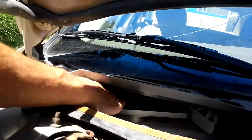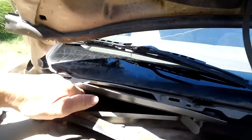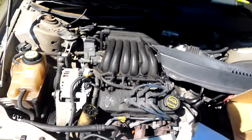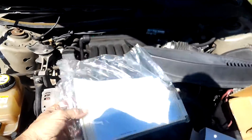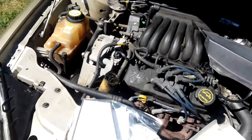I think I got it — a little leaf in there. If you park under trees a lot, especially pine trees, debris gets in there and it will clog the filter up. You'll notice when you turn your fan on — the blower inside — it doesn't seem like it's pushing a lot of air. This is usually what happens: you get a lot of dirt in there and it makes it pretty nasty.